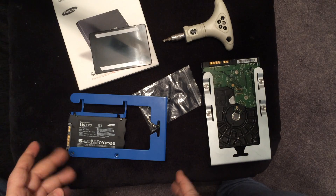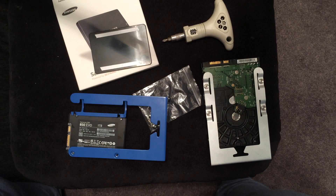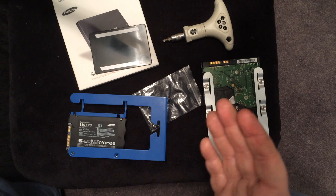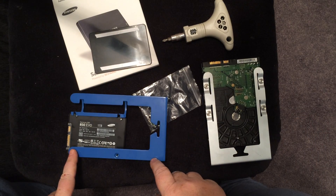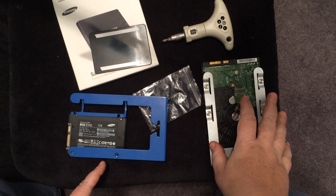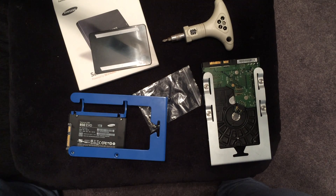It's that simple to do this upgrade — I highly recommend it. The drives can go anywhere from $69 and up, and some are a little faster, some a little slower. If you're worried about opening up the Mac Pro door, there's a little lever on the left side — you click it open and there are the drives. You pull out the silver sled and replace it with the blue one with the solid state drive connected. You're going to have to initialize this drive when you get it into the computer for the first time, but you can use Disk Utility for that. You can also just backup whatever operating system you have and migrate it over — there's a migration tool for that in your utilities folder.